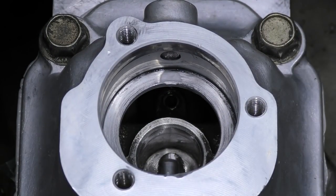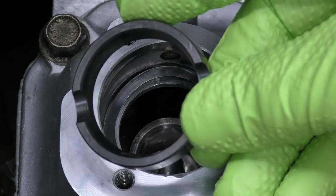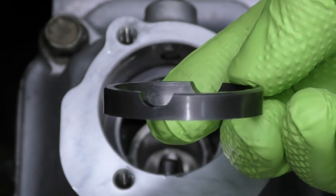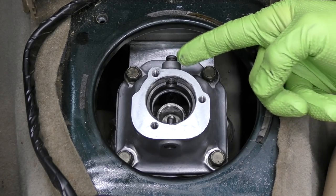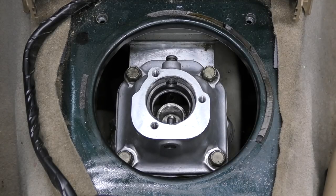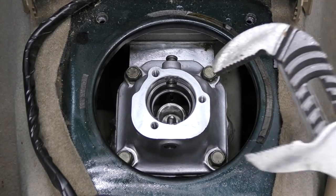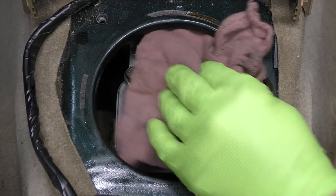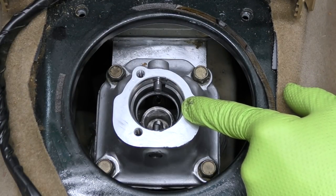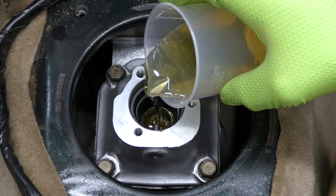Okay, let's go ahead and get this all put back together. The steps to putting everything back together are pretty important. They go like this: first the wavy washer without the tabs on it — we're going to install that one. Then we have the bushing piece that has the two cutouts in it — it needs to go next. One cutout goes underneath one pin. Set that in. Next we need to drive the pin back through. We're going to take a big pair of pliers, throw a towel over this so we don't tear the housing up. Get on the back side and squeeze it, and that should drive that pin back in. Next we need to go ahead and fill our turret housing. The spec for the fill of the turret housing is 90 cc's or right at 90 milliliters. We're using the same transmission fluid that we're going to be doing the service with. Fill her up — that is definitely more than I took out.